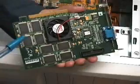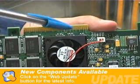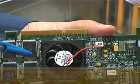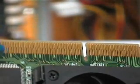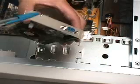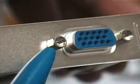This is the video card or video adapter. If your motherboard does not have an AGP slot, you will be installing a PCI video adapter card. Either way, they install the same way. For our AGP card, the connector edge shows a notch that has to match the AGP slot when it is inserted, which ensures you have the correct orientation. This is the connector for the monitor. The connector has to face the back of the case.